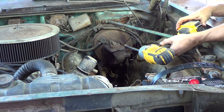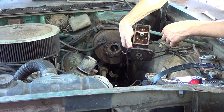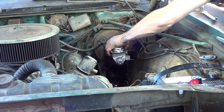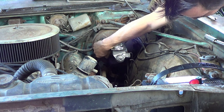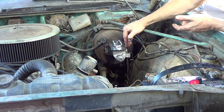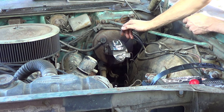I'm going to mess this one up. It's only got fluid in there because I put fluid in it the other day. You probably can't see it, but there's crud in there. Alright, let's grab the new one — hopefully it's the right one. But Ben, aren't you going to bench bleed it? No, I'm not. Why? That's kind of a gimmick. I'm going to get the air out of the master cylinder or the brakes aren't going to work — it's not that hard. We'll bust these loose. I'm not going to do it, don't need to do it. I'm going to get the air out anyway, so I'm not going to waste my time playing games.